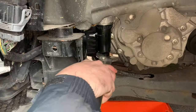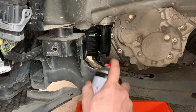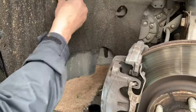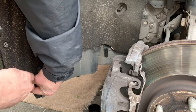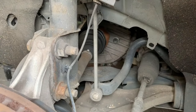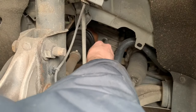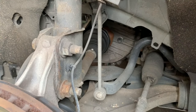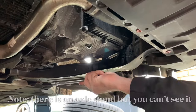Now you don't over tighten these. I see it's tight now - I'm going to give it a little bit of a clean up. Let's put this back in. When we do fill it up, checking the level is right there at that little bolt - we'll undo that shortly and check the level. Let's get the bottom tightened up. I've tightened up the two sump bolts, put the torque below - that's all tight now and that'll all be cleaned up in a minute.